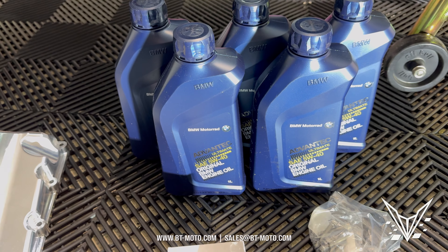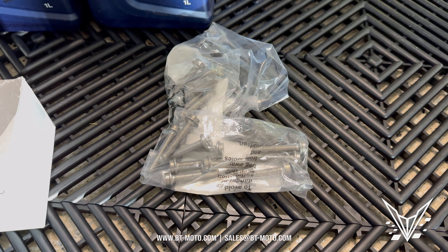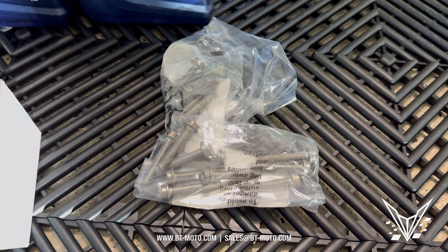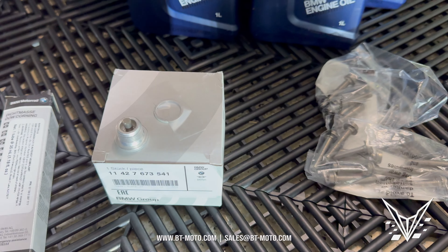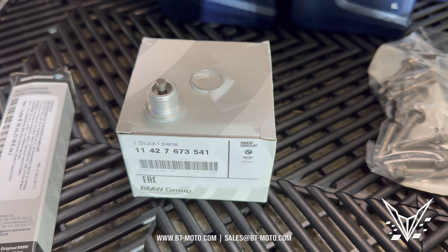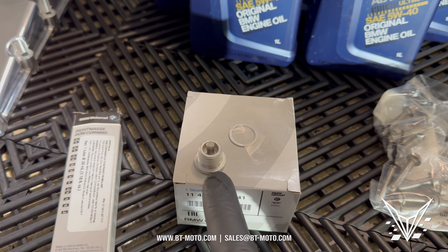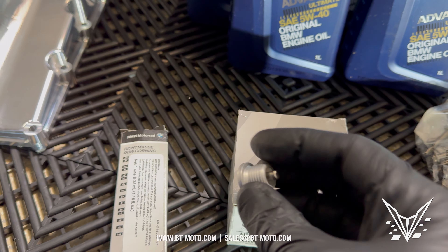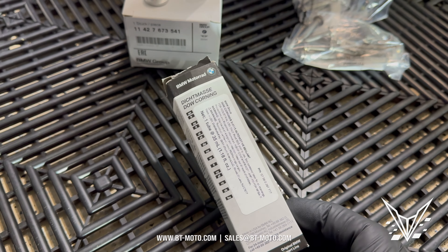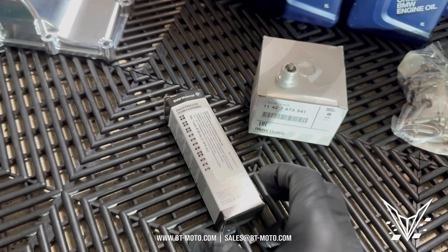You need five quarts of oil — I just go with the BMW synthetic oil. You're also going to need at least 14 torque-to-yield screws. When I say torque-to-yield, that means you cannot use the stock ones again; they stretch when you torque them properly, so you have to get brand new ones. I also recommend an oil filter — get the skinny oil filter. There's a skinny one and a long one; the skinny one's easier to get in there and it's just as effective. You also need a gasket for the drain plug. You can reuse your drain plug and the stock drain plug will work on our billet oil pan just fine. Also make sure you get the BMW RTV — you can probably cheap out and get some other stuff, but I always just get the BMW RTV. It's the best stuff, never any problems, never any leaking.